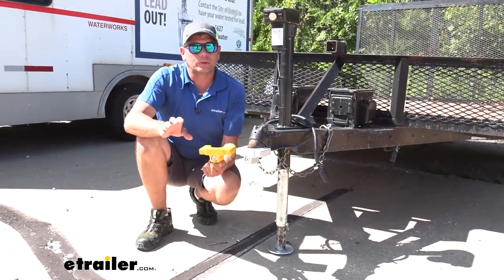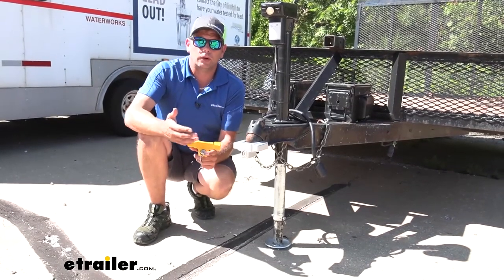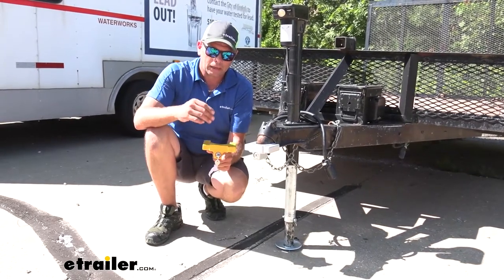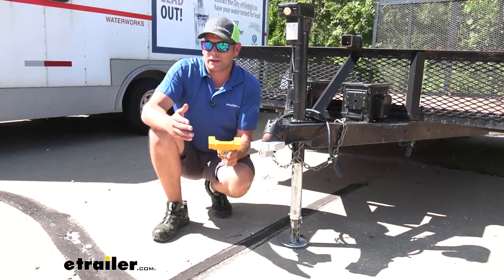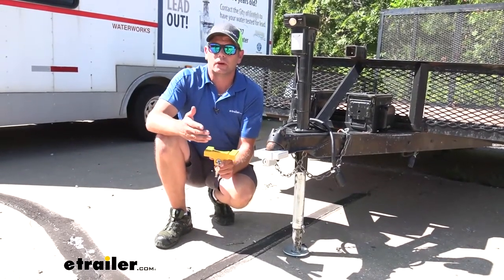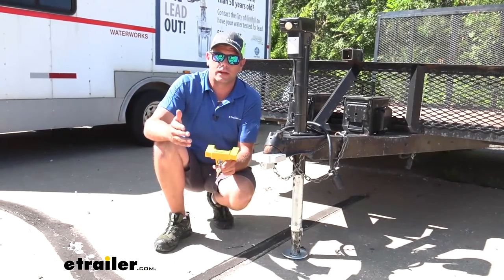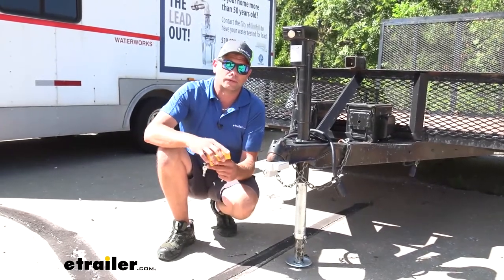As far as picking the right size, there's a guide we can use. If you're into smaller boats, smaller utility trailers, or even some older pop-up campers, those would have inch-and-seven-eighths or two-inch couplers — two-inch being more typical — so you'll want the inch-and-seven-eighths or two-inch version. For larger trailers — small to heavy-duty utility trailers, enclosed trailers, larger boats without brakes (most with brakes have a surge coupler, which this won't work on) — I'd go with the larger two-and-five-sixteenths size, so that if you change trailers or couplers, it'll still work and you won't have to purchase something different.